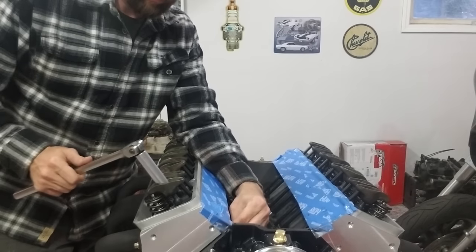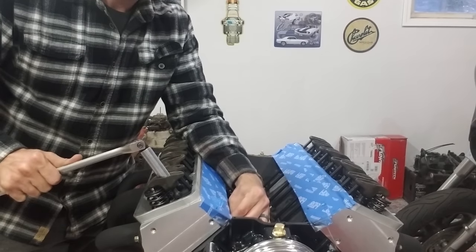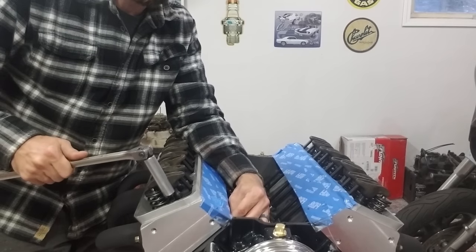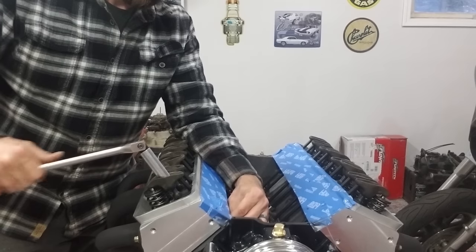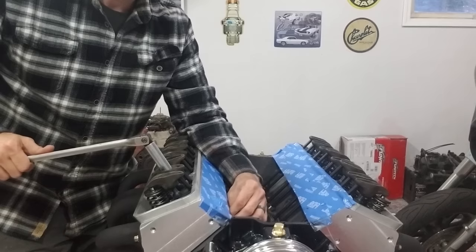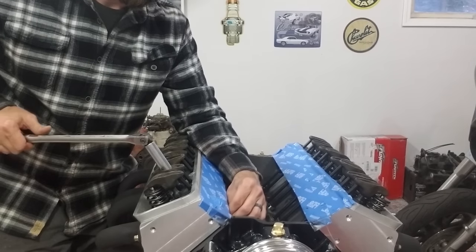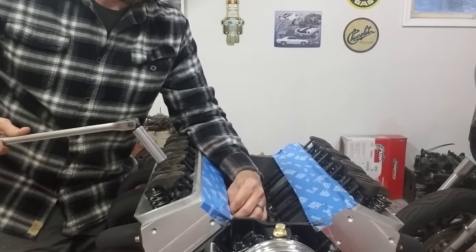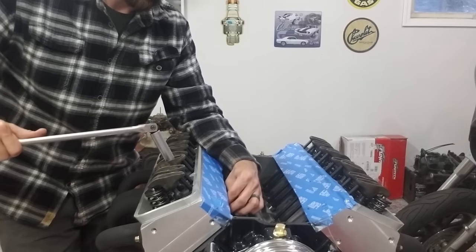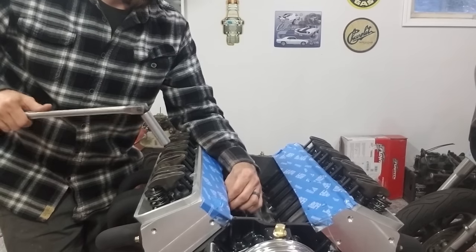All I'm going to do is take my push rod and spin it with my finger. That one was actually tight; this one's still spinning. I'm just going to gently tighten this up until there's a little bit of tension. As soon as I feel that tension, I'm going to stop. I make sure my socket isn't pressing down on the rocker, and I go until I get tension. I use a breaker bar because if I need to go backwards, I don't have to keep repositioning. All we're trying to do is get this to zero lash — making contact in the push rod bucket and the rocker arm.